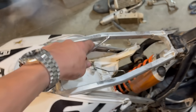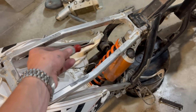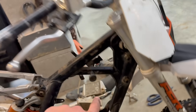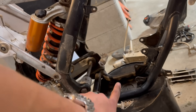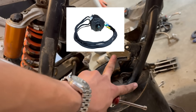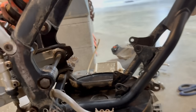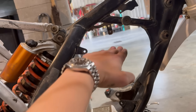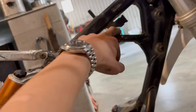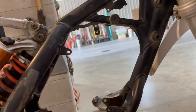I'm going to fit the controller probably right over where the airbox was. I'm going to have to cut a part of this frame out, but depending on what motor I get — I'm in between the FW11 or GTS11. I thought about the QS165, but I think it's just way too big for this and I'm never going to use the full potential of it. Probably going to go GTS11. It'll probably come up to here with the 32 amp battery that I have already.